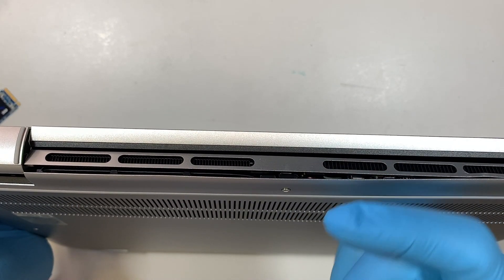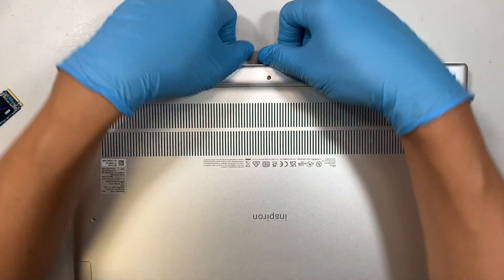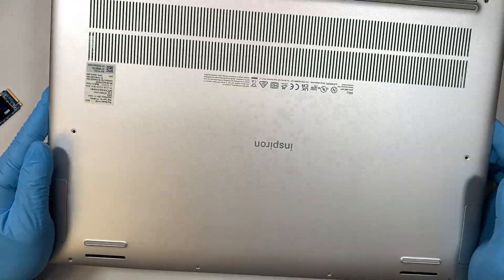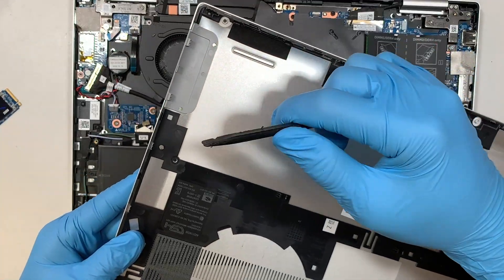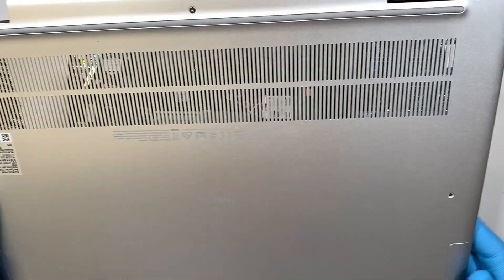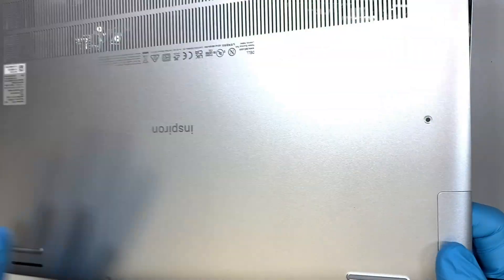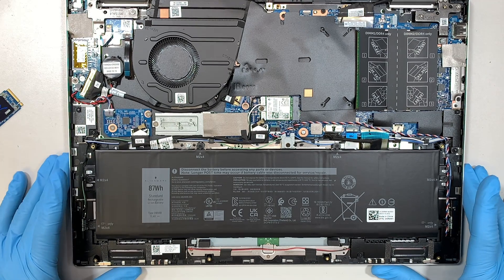At this point you can see that the top screw has separated the back cover, giving you a little room to get your finger underneath and start prying it open. It should pop right open, but if you have difficulty, get a plastic prying tool and start prying along the side of the back cover. If this is your first time it may be tighter because it has little clips that clip onto the side of the computer.